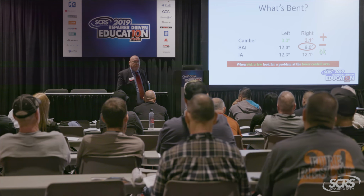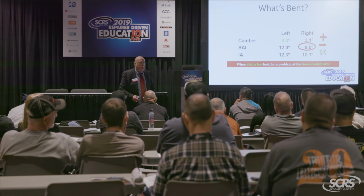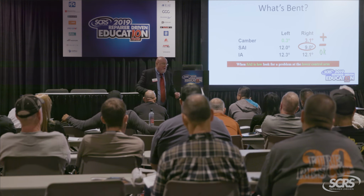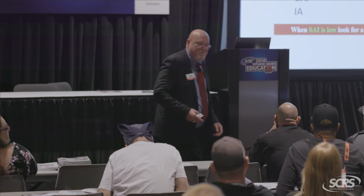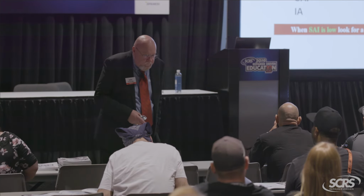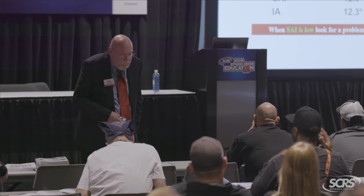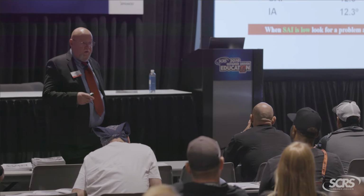Is this starting to make sense? Right? The devil is in the little problems add up to big problems. All right, here comes number 3. The numbers never lie. Okay? Yes, sir. So my question is, if you have slight movement, now I know you have excessive movement here. Mm-hmm. What transitions you from changing a part to putting on like a camber kit? I never put on a camber kit until I've looked at the numbers.